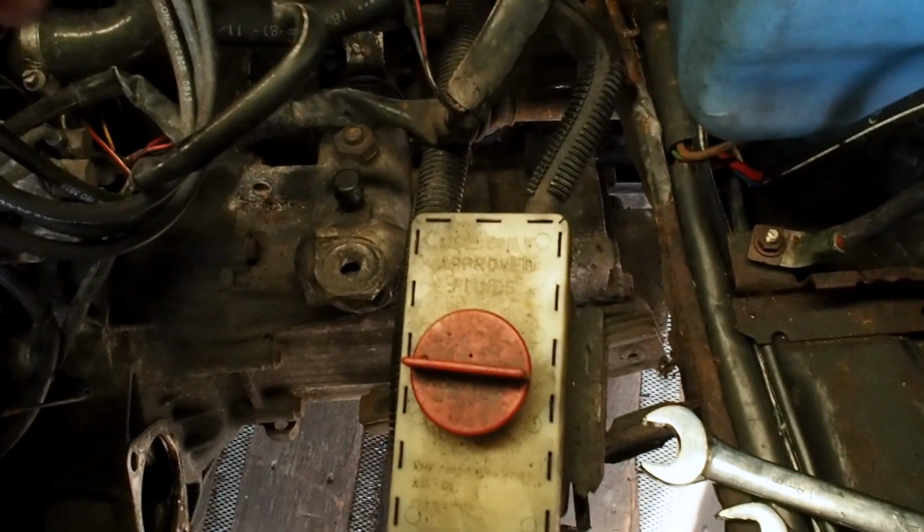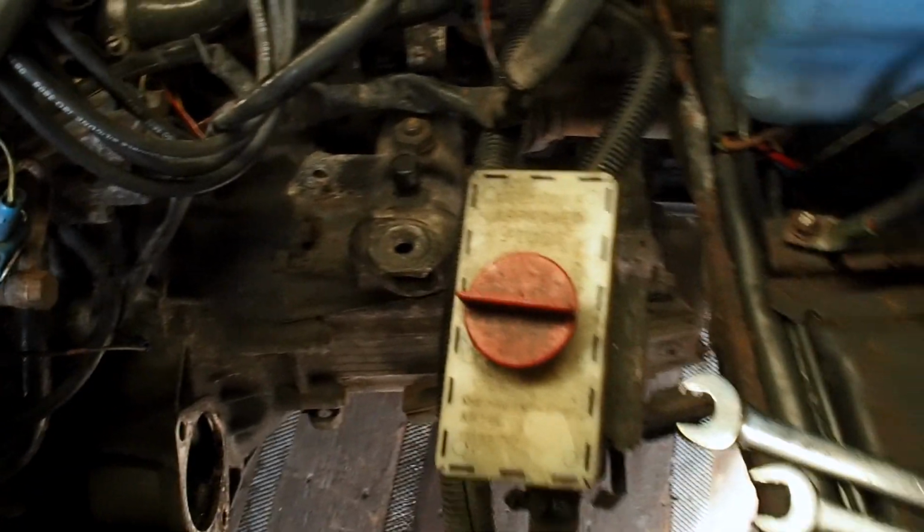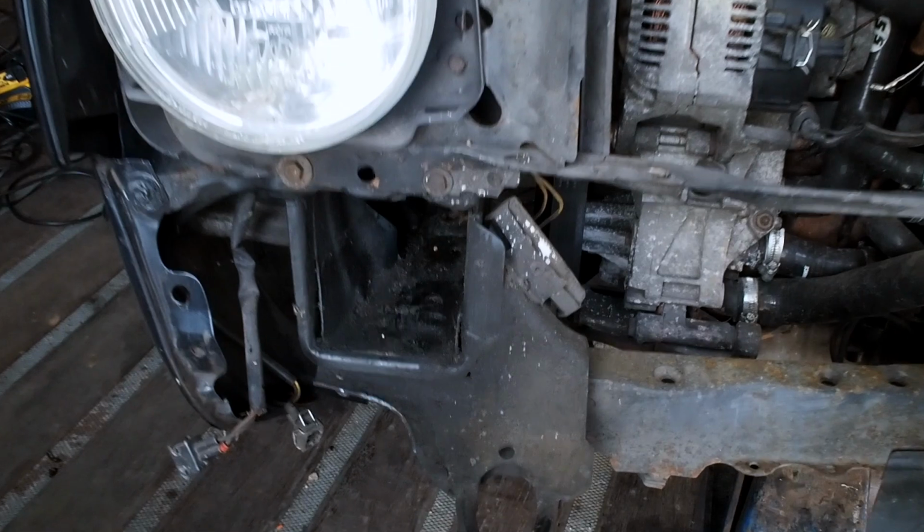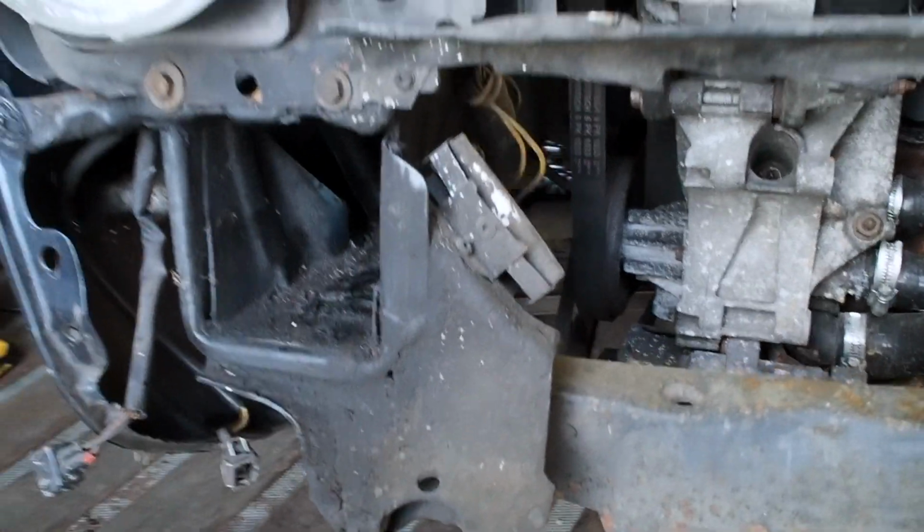Okay, so half an hour in, I've taken off the wheels, jacked it up already, the starter motor is off, the front bracket's off, and also that rear brace that goes across there is off. Speedo cable's off, the gear linkage has all been done as well. Also I've removed the front bumper. It also gives you a chance to see, it's quite hard nowadays to find all these cowlings intact on the Mark II. There's no crash accident damage on this. It's all very straight and original.